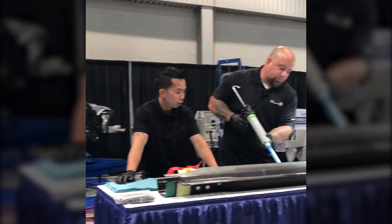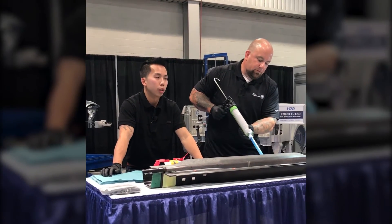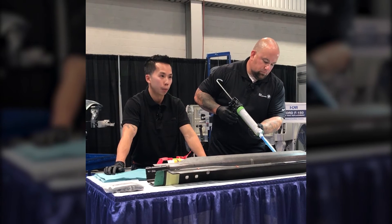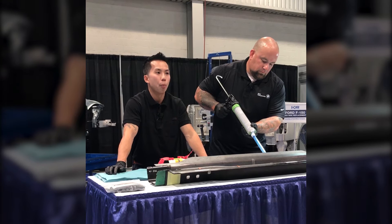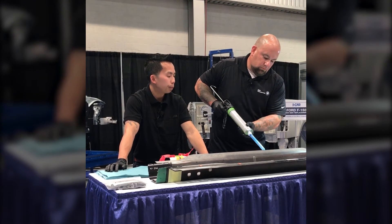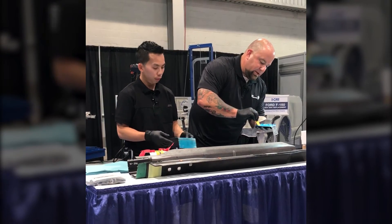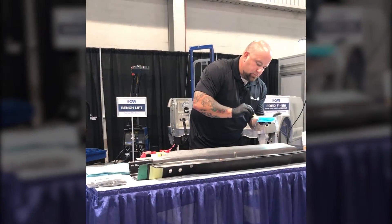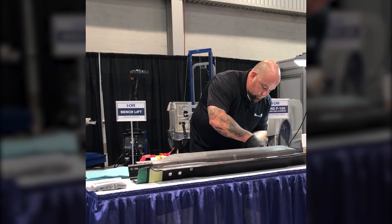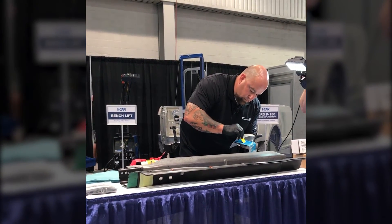On our part, we're just going to want to have a thin transparent layer on it. This does two purposes: it does our corrosion protection as one purpose, but the other purpose is our carbon glue — the K2 — sticks better to the K1 glue than to the actual bare metal. Plus our K2, the carbon glue, doesn't have any epoxy base inside the glue itself. Take the spreader and just want a nice thin even coat over the whole surface. The reason we don't want to go any thicker is because if you put too much thick material on there and then you put another coat of K2 adhesive on there, it might make the panel stick out and you're not going to get a flush fitment. So we want to keep it as thin as possible, just enough to cover every single inch of the bare metal.